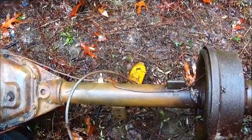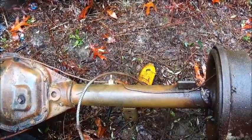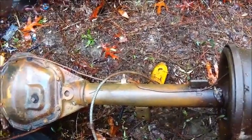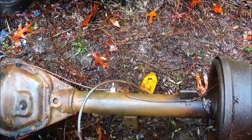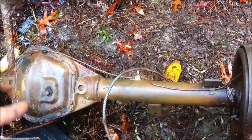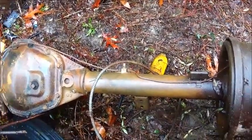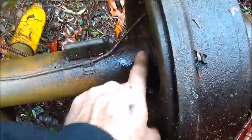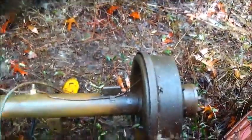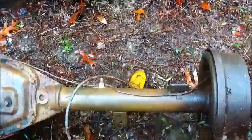And we're going to check the other rear. We've got a 410 gear here, and I may pull the cover off one of the other ones and show you. It's raining out here a little bit, so I'm trying to stay out of it the most I can. But anyway, so Dana 60, 410 gear. We're going to get this one around here, because we're definitely going to use the hubs now. Dana 80, so everybody knows, the axle tubes are bigger, and they actually taper down smaller before they go into the brake backing plate mount. So you can spot them easy. They're a lot bigger than these rears. So, all right, let's go look at the other one.